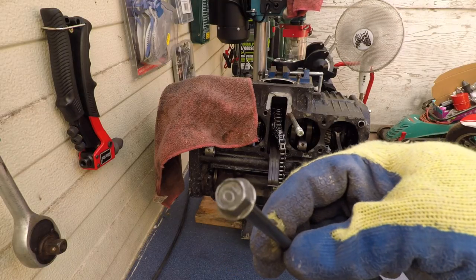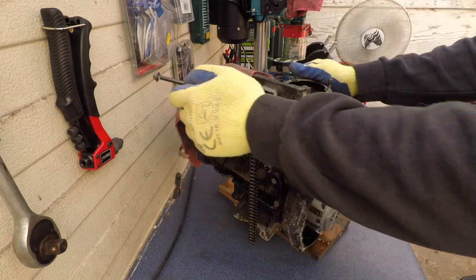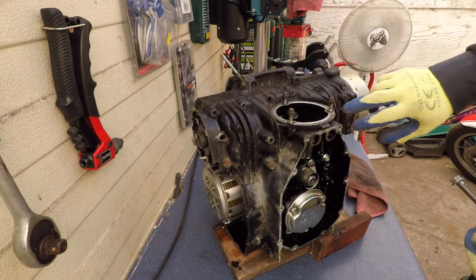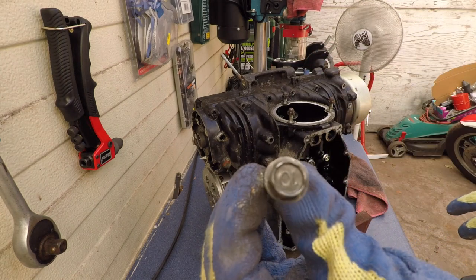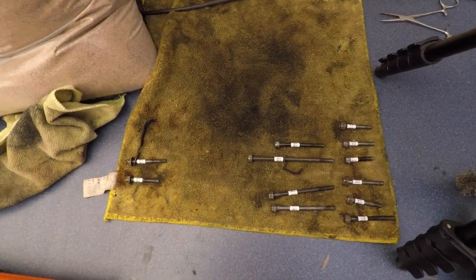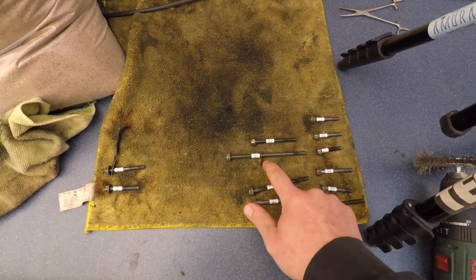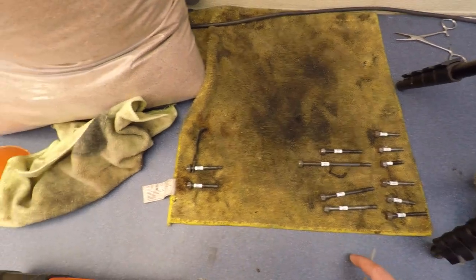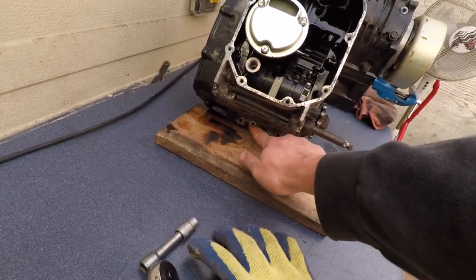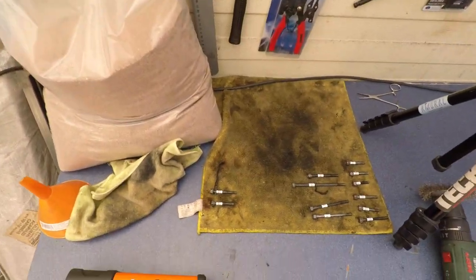Another thing to note, this is the third screw from the second row on the bottom. So it's screw number 1, 2, 3 here. This is mark 10 as opposed to 7. More piston parts. One thing to note, the third screw from row number 2 has a clip to hold the signal generator wire, and the second screw from row number 5, which is this one, also had a clip to hold the signal generator wire and some other wires. Yeah, there were some wires there.